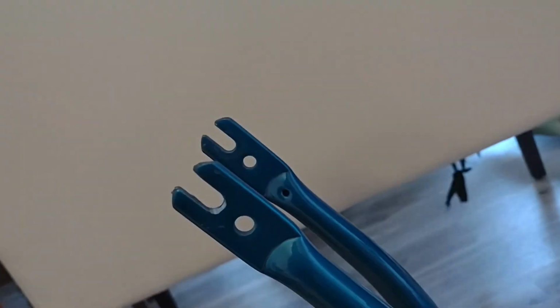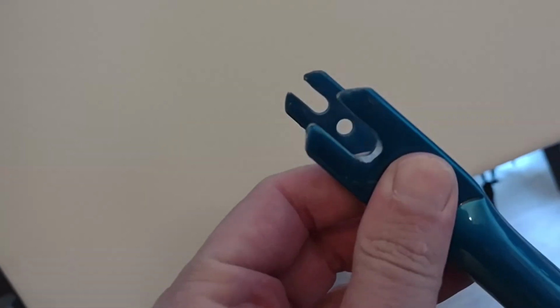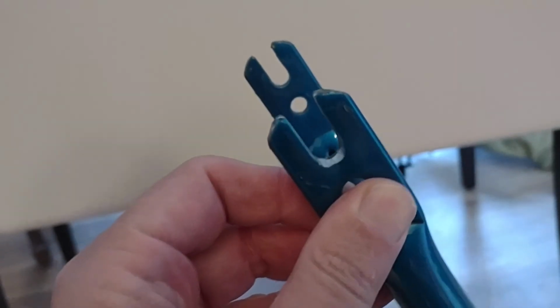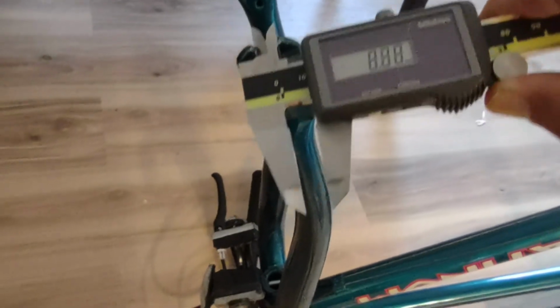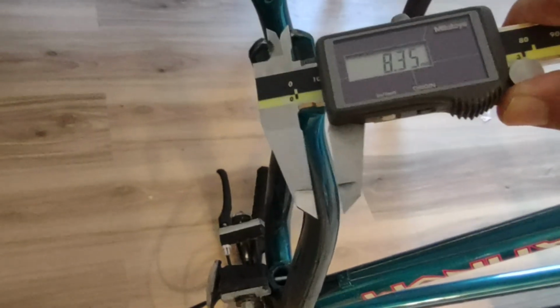Any good. Might take a long time to grind it away with this grinder. I'll get my calipers down here and measure that, see if we've made any progress. Okay, so here's our calipers, and let's just take a measure here. Okay, so looks like it's 8.8, 8.9, kind of at the top. I think it's not as wide at the bottom.